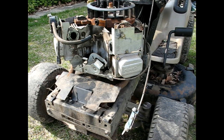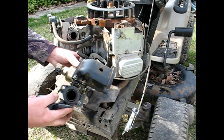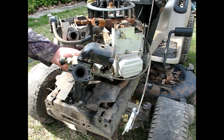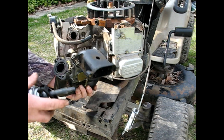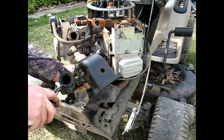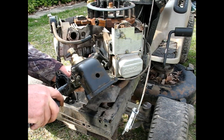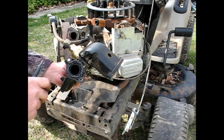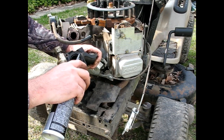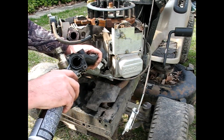All right, back here at the tractor that this came off of. I'm going to use some quick gasket sealant. These have a rubber ring installed on them from the factory. And I probably should get another one, but I don't have one. So I'm going to put this on there for a quick little insurance that we got a proper seal. And I'm putting quite a bit because this can go into that inner ring also, not just the outer ring. Normally I wouldn't put near that much because it would just squish into the engine or into the intake manifold and slow down the flow.